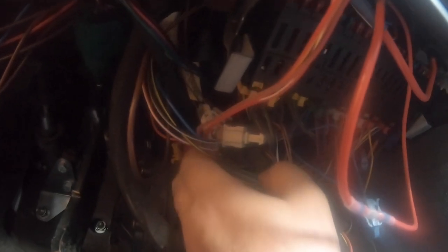This is the loom side and that is the fuse box ECU side over there. You'll have to rummage around amongst the crow's nest of wires behind the fuse box. What you're looking for is a little red four pin connector, roughly behind and above the accelerator pedal — that's where you'll find it.